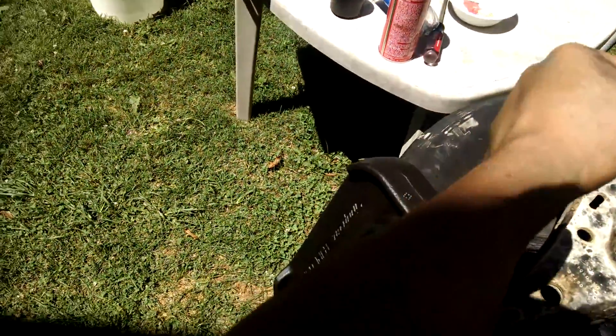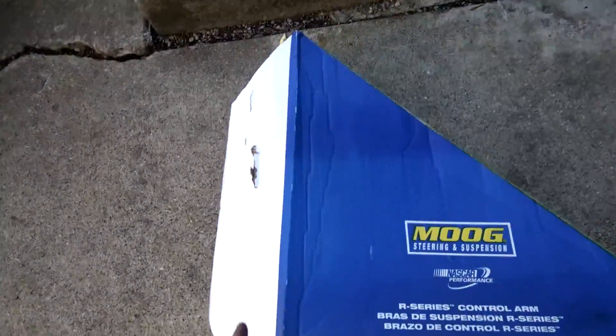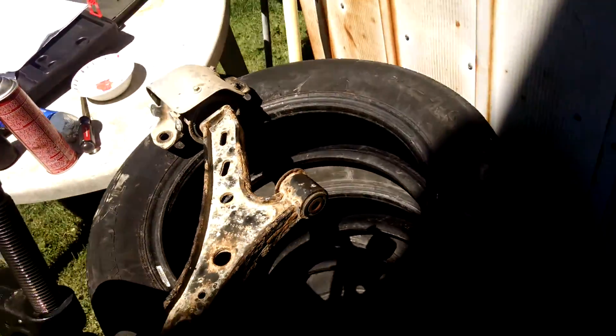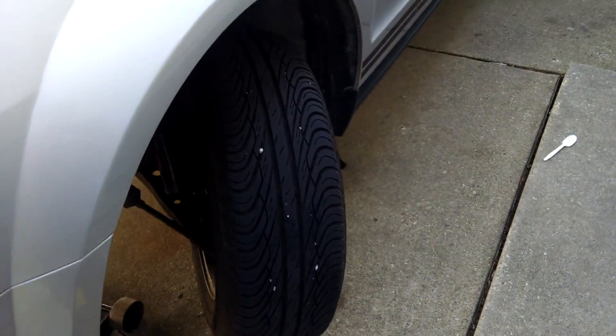There's no other way that I can explain this lip other than it has a hook, which is a flare — picture a bubble flare, kind of like that. So I'm giving up on this one. This might be the more expensive route, however in the long run this is the cheaper route, because you are getting a new ball joint and it comes with brand new bushings. The bushings on the old one are actually pretty dry, so they are probably soon to follow. It's an 11-year-old part, so might as well just replace it.